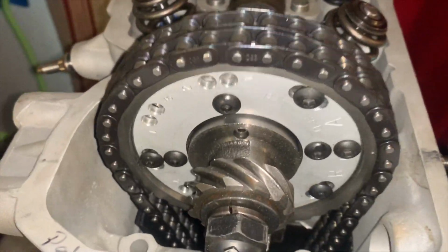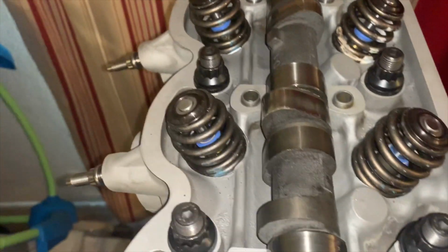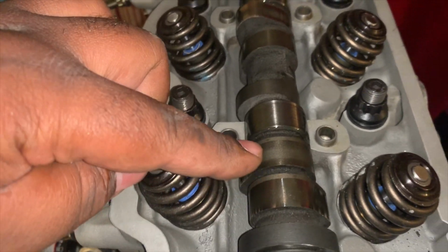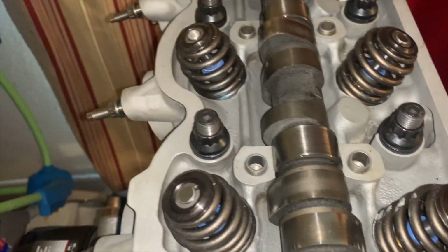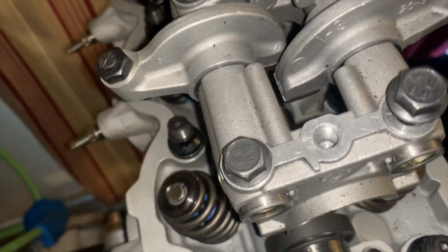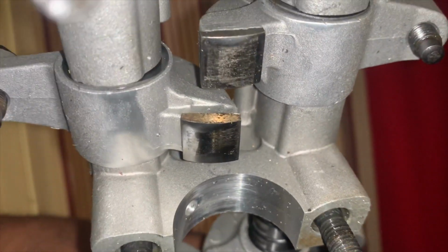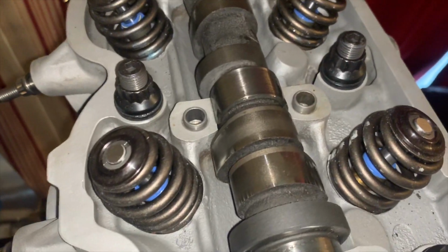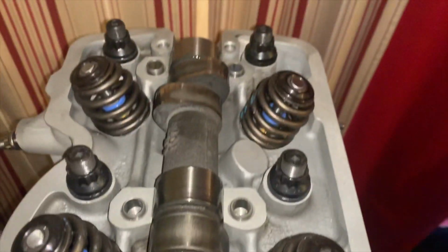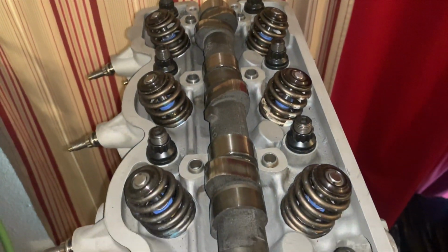And once that's done, now you would have to put in your rear seal, and you're going to lubricate every single lobe, because now you're putting this puppy on, and you want to make sure all of the tappets have lubrication. So we're going to lay down some more lube across the whole cam assembly, get the seal in, and then we're going to lock it down.